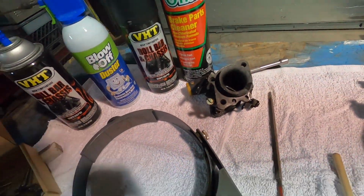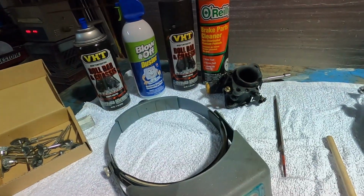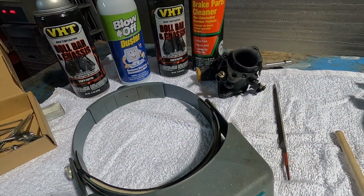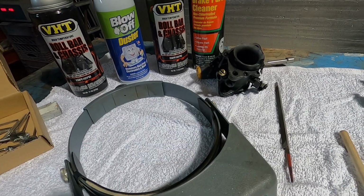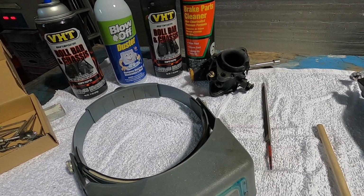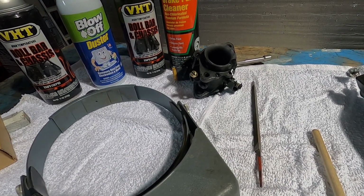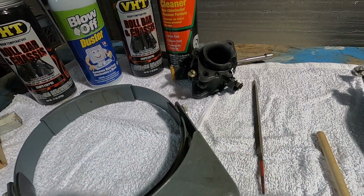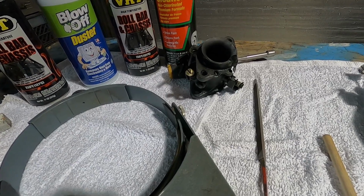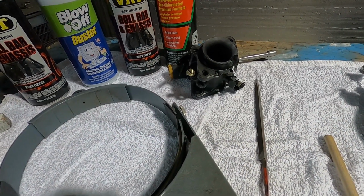We knew that this carburetor had an air leak. We didn't know where it was. We just decided to tear the whole thing down and do a complete rebuild. And on this particular carburetor, which is another Carter, I found completely dried up gaskets which had cracked and caused an air leak. And then I felt this high spot which prevented the next level of the carburetor body from sitting square on the base, thereby again creating an air leak. The complaint is a mid-range flat spot when driving. So hopefully when we get done with that carburetor, that will be all straightened out.